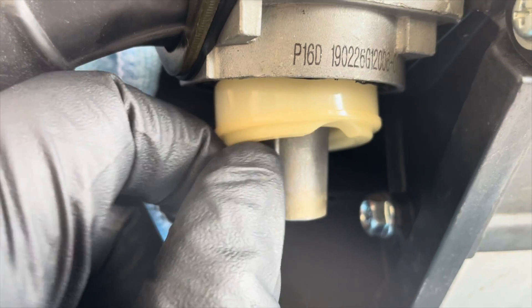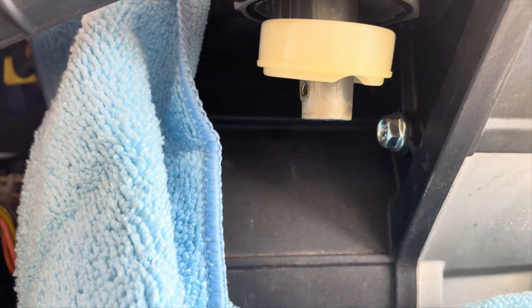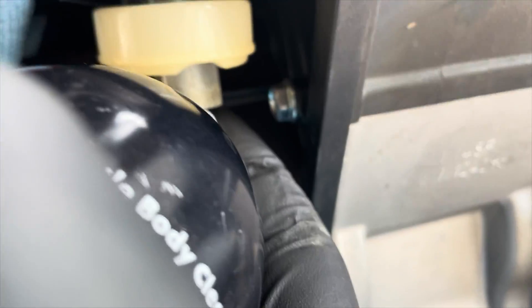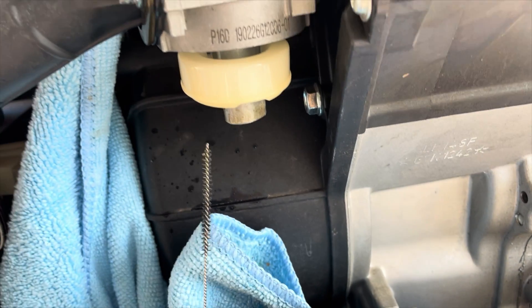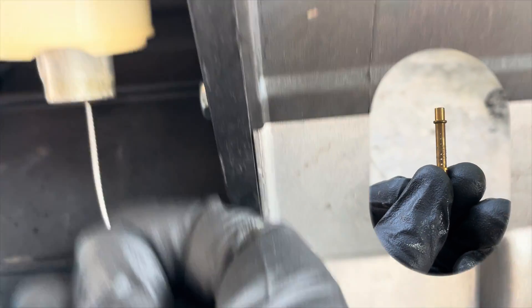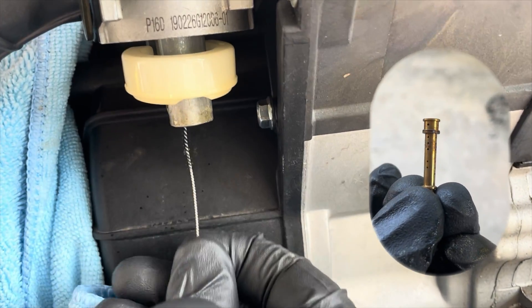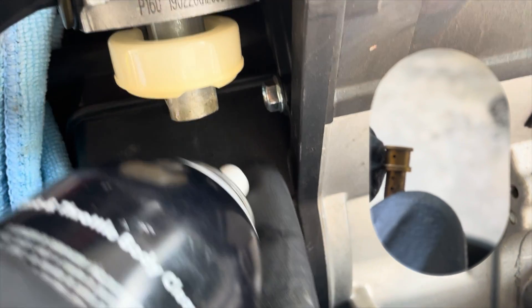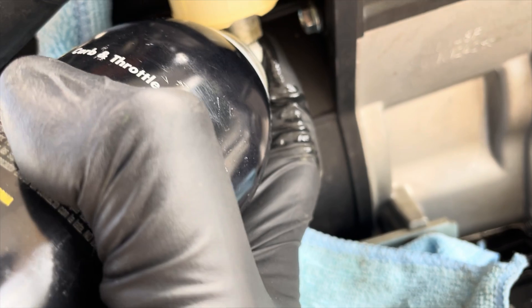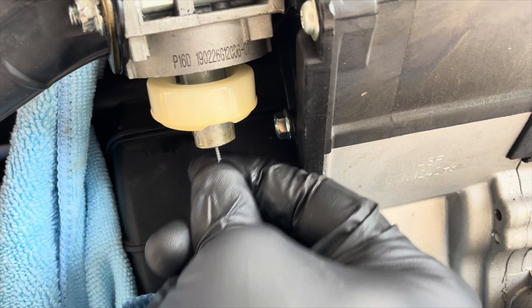If your generator won't start, there's a 90% chance you have a main jet that is clogged. You can do this whole process — clean the main jet, clean the carburetor — and fix your problem. In this case we're going to clean the emulsion tube. The emulsion tube is used to maintain the air-fuel ratio at all speeds. It consists of a well with a main metering jet at its bottom; the jet has holes on its sides in communication with atmospheric air. Air is drawn through the holes into the well and fuel is emulsified. When the throttle valve is open, the reduced throat pressure causes the emulsified fuel to mix with air, reducing richness of mixture. As speed increases, the holes in the central tube are progressively uncovered, maintaining the air-to-fuel ratio.